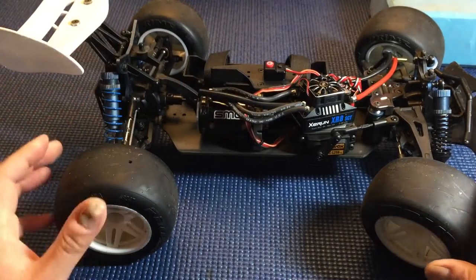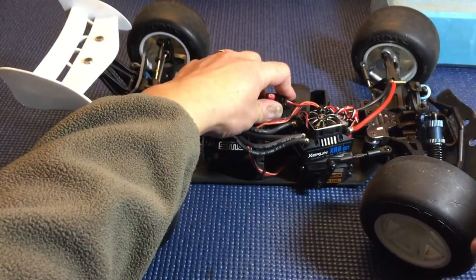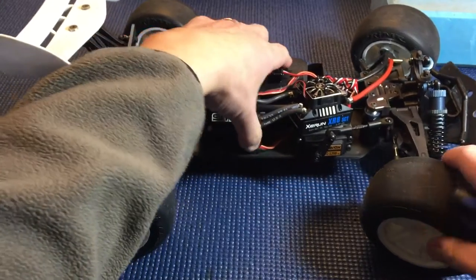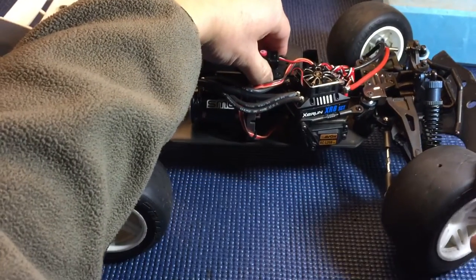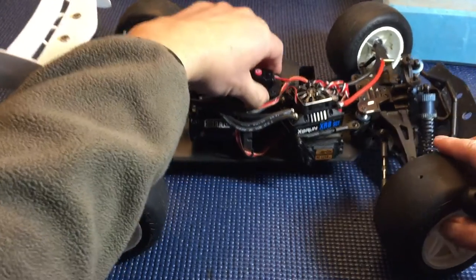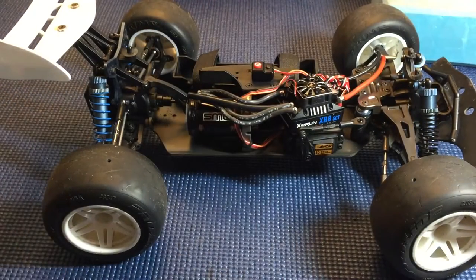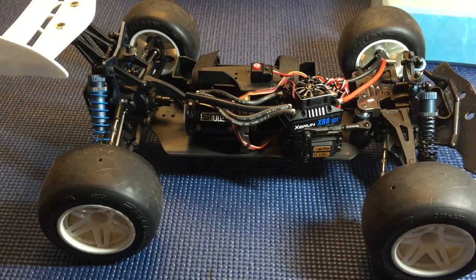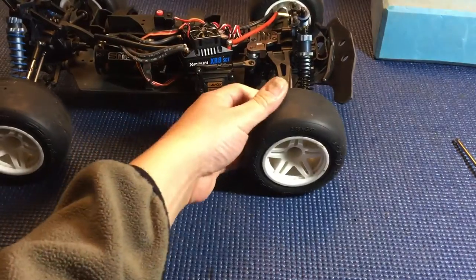So when you set the endpoints, just go far right, then test the car all the way up and all the way down, and make sure you're not actually pushing against the servo when you do that. Do the same thing on the other side — go far left and push the arms through the full range of motion. You'll actually find that the steering is probably limited a little bit. So why is the servo being pushed back? I've been looking into that, and there are a few things going on.